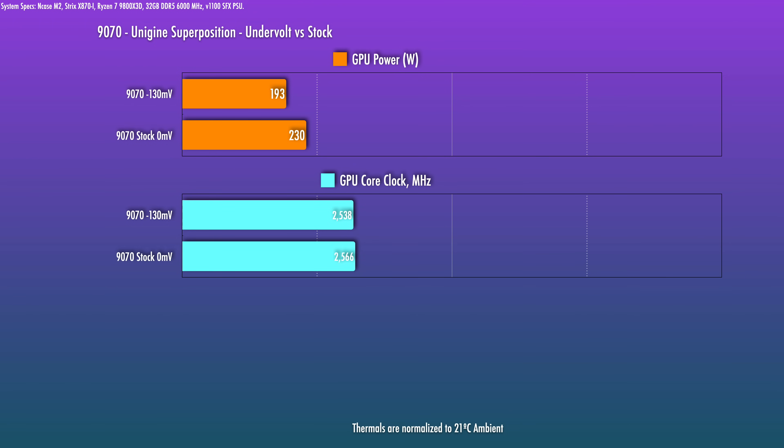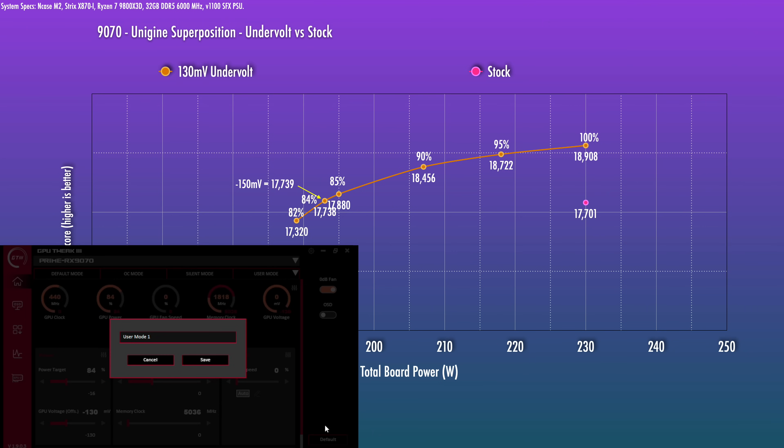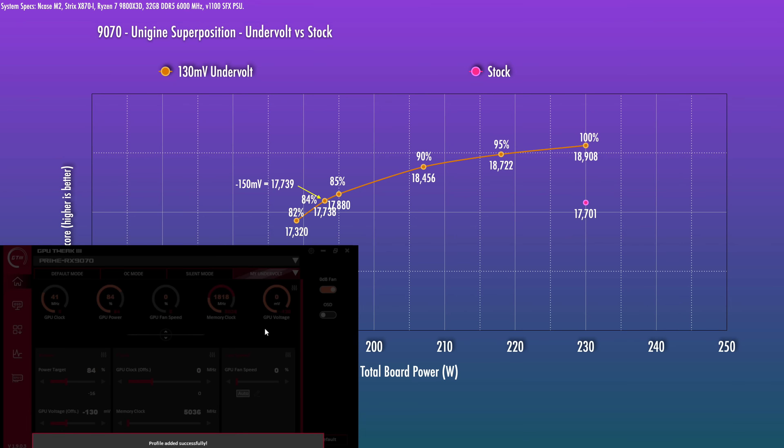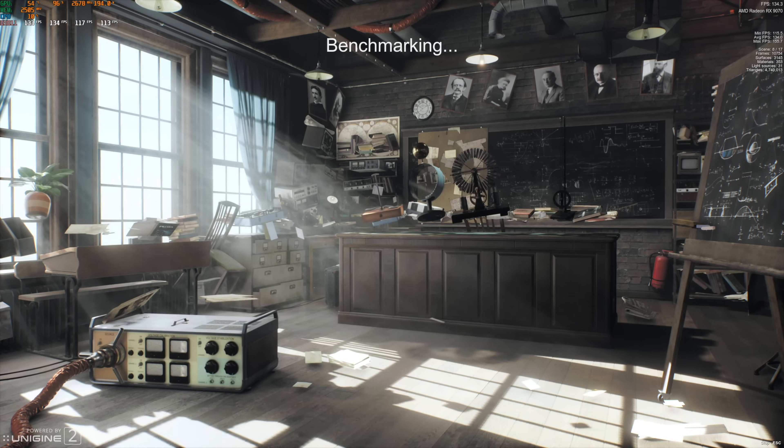Quick check on the clock speeds — pretty similar versus the stock speed, so all good here. I mentioned earlier you can try dialing down the voltage offset some more. For example, I tried going back down to minus 150 millivolts. While it was not unstable at this reduced power level, there was not much of an improvement either, so minus 130 seems like a perfectly fine spot. Go ahead and save your profile at this point. Just do what you normally load the GPU with — game with it, see if things are stable enough for you. Personally, if it works without hiccups for the titles or applications you play or use, I'd be comfortable just leaving it that way. You can run Furmark or something like that if you want to — it's up to you.